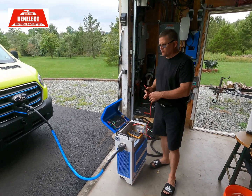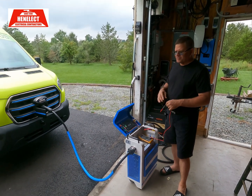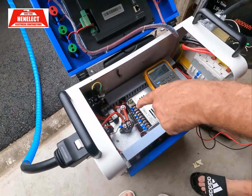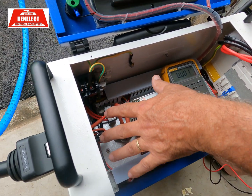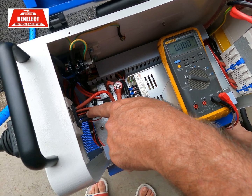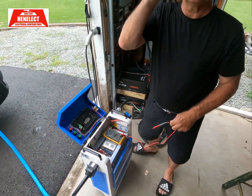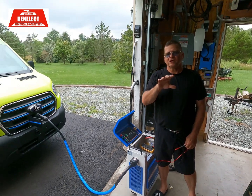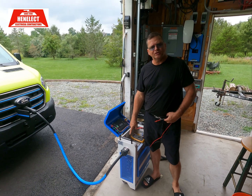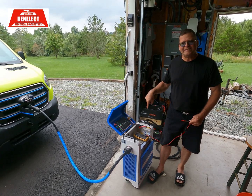This device is communicating with the car and opening up its DC bus. The vehicle knows I have a high-speed DC fast charger, but the vehicle doesn't know where the DC comes from. So what I'm going to do is disconnect my wires here and put the direct output of my solar panels right to the DC bus. I'll keep all the control pilot signals intact — here's my plug present signal and here's my DC output. I'll disconnect that and connect my solar panels through a 400-volt buck boost so I can tweak the output down to 385 volts, then connect that directly to the car's input.